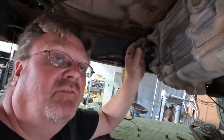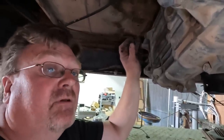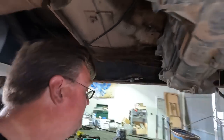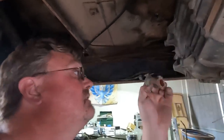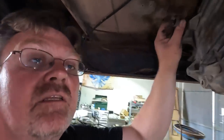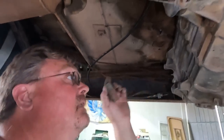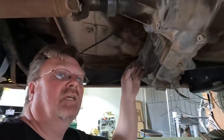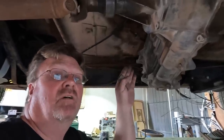Here's my adapter plan: that's a little bit of eighth-inch fuel line tubing left over from an outboard motor project. I just slid it over the cable — by spinning it, it spins the cable — so I'm going to slide that tubing over the other cable and they might actually drive each other. I've got rubber tubing with two different sizes: I think I can shove this over both ends, hose clamp it in place to keep everything in alignment. The inner tube will drive it. Will this work? I have no idea. It'll be a nice surprise when I start driving. But if nothing else, it was free.